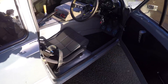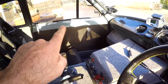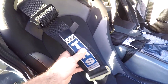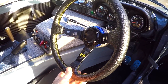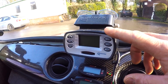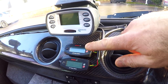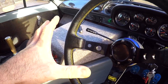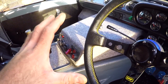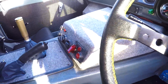Let's have a look in the cockpit. Stupidly light fiberglass door. Got some more carbon fiber in there with the dash top and the door cards. A nice roll cage in the back. Really smart bucket seats with TRS harnesses. OMP deep dish steering wheel. Some nice aftermarket gauges in the dashboard. On the dash we've got a Race Logic data logger, and below that a couple of AFR gauges to monitor the air fuel ratio of the engine — one per side for the V8. There's a really wide transmission tunnel governed by the shape of the tubular TVR chassis beneath. Definitely really different to your average Escort build, but really cool.